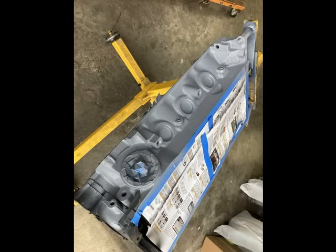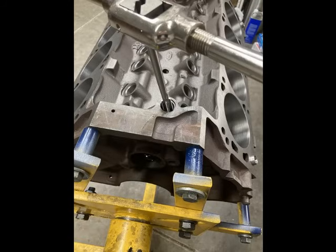As far as that goes, once the block is machined, then we do some final prep work. If you want to know what prep work I do for the Windsor blocks, we just did a nice video on oil mods for every engine family. And as you can see in this one, I opted to tap the hole down inside of the block where the oil comes up to touch the lifter galleries, and tap that for a restrictor to restrict the oil to the lifters. That ensures more oil gets to the mains and the rods, and good benefit from that.